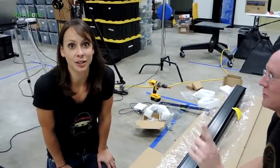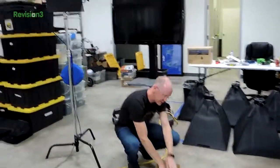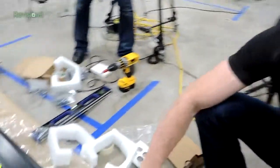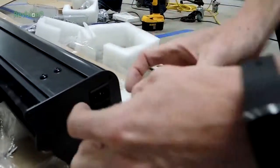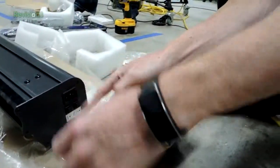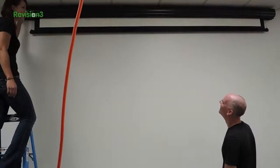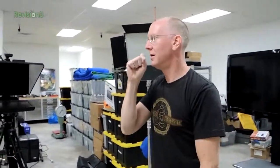Step three: play with the remote control. It's automatic and it comes down with a button. On this end there's a plug because this is an electric screen — there's a 110 outlet, and we're going to have the electrician put an outlet on the wall right beside this and use a really short 12-inch cable. This has two buttons for up and down so you can manually raise and lower it. We also have to unscrew these set screws — those are just to keep it secure during shipping. So: mount the two plates on the wall, take those two screws out, drop it in place, plug it in, and you're done.